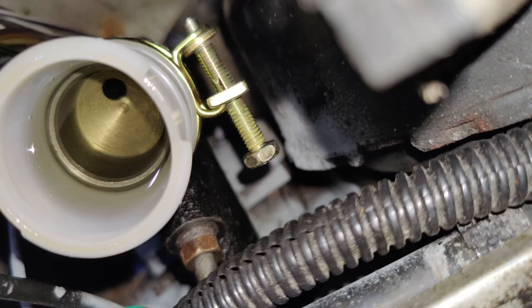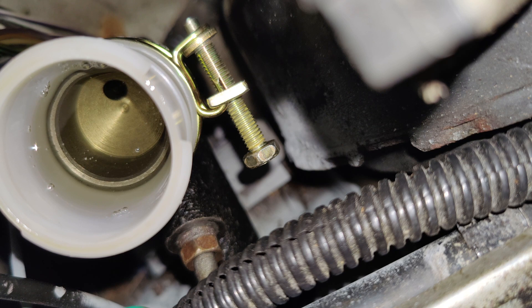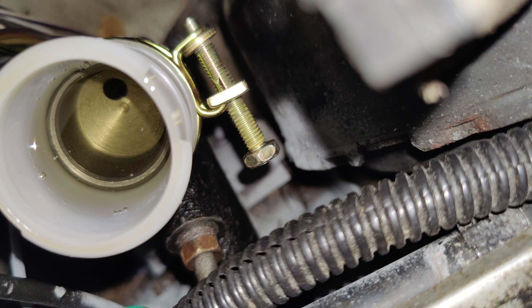Now you can see a few little bubbles on the surface — there's some bubbles coming out. This is for the YouTubes, baby — show me the bubbles. I can see the camera right now so I can watch the bubbles in real time. Clutch pedal down — nothing. And then when I clutch back out, that's when the bubbles usually come. Down, up. Down, up. About to get myself a charley horse just doing this funny position. I don't see any more bubbles on camera, so we might actually be good.